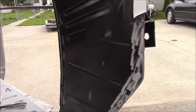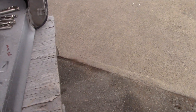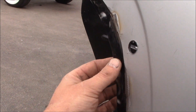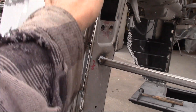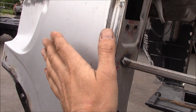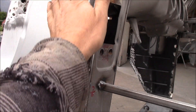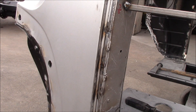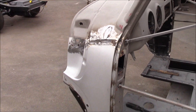So that's pretty much it — we got her all welded up. We put our inner cowl piece on, we got our new lower hinge pocket piece on, and then of course we got our cowl center piece — whatever they want to call it — and then we got our outer cowl section on. So basically there's no body work to be done here. If you want it absolutely poker straight, Dave will block it down, skim coat it with a thin layer of body filler, knock down any little highs and lows, and that's how you get it perfect. But if you're happy with how it looks, you could just sand it and paint it and away you go.